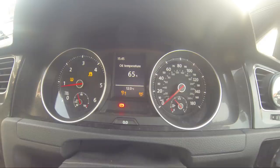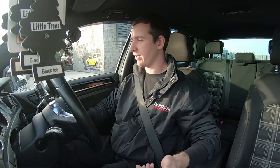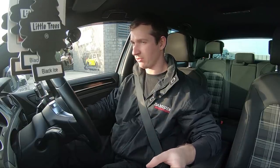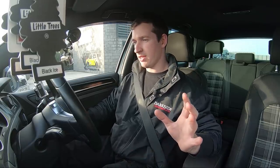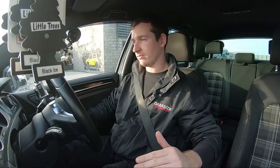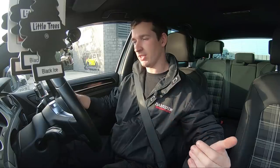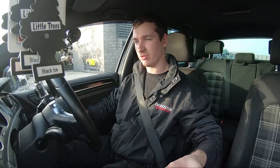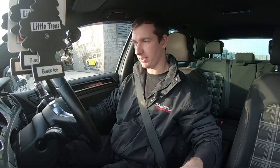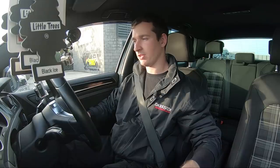On a four-wheel drive car — like Golf R's, Tiguans, all that sort of stuff, MQB platform, some of the new Transporter Vans T6 stuff — if it's four-wheel drive, it'll just run on the dyno fine without the back wheels turning. So you don't need to unplug Haldex or unplug fuses. For a front-wheel drive, some cars you have an absolute pain unplugging all sorts of fuses. Not going to need to on this one.